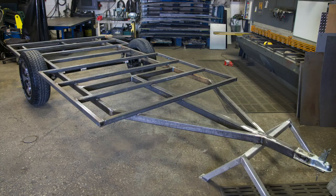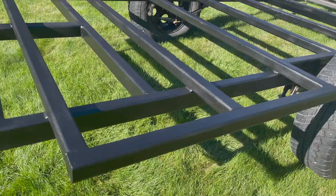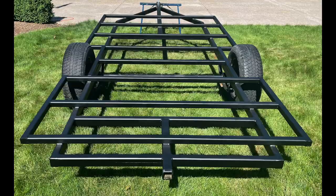Number two mistake is the frame itself. The frame I think is a work of art — I designed it and had my buddy Andrew from Windsor Metalworks weld it for me. It was a great partnership. Everyone told me once I got the steel frame built to have it powder coated or treated properly with Line-X or something similar. If I had to do it again I certainly would have done that, but I cheaped out, afraid of the expense and timeframe. So I literally coated it with flex seal, thinking it would give it a solid waterproof coat with no issues. That has been a failure. Now I'm going to have to sand off the frame — it's got a lot of surface rust — and redo it properly with a different coating. So that is definitely my number two mistake.